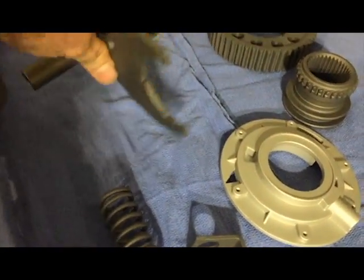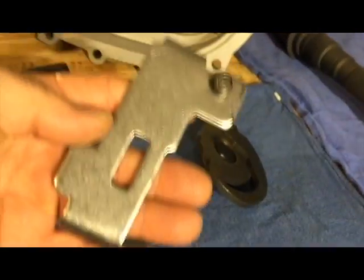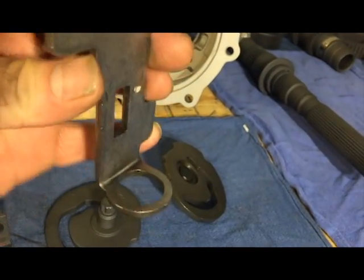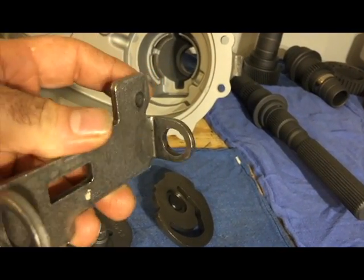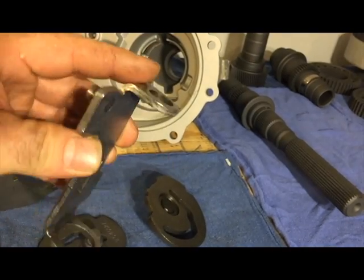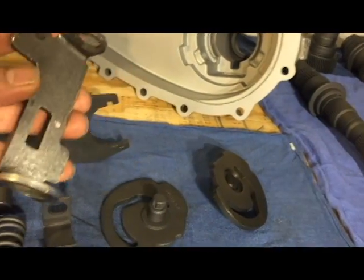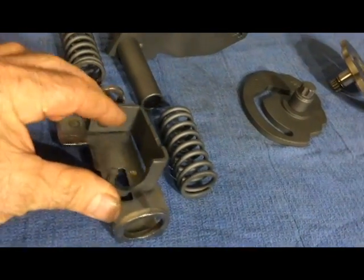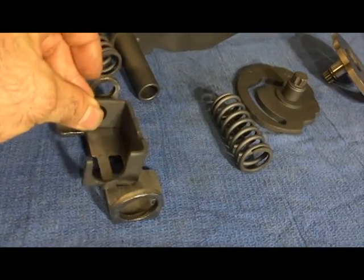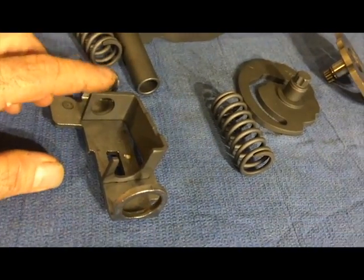Here's the range fork right there. Some of the parts — the springs and this piece right here — I didn't have this coated and I haven't polished it yet. I still have to clean it up. I got some really nice polishing pads from Amazon that I'm going to use. But these parts interact and there's a lot of tension and pressure on them. These parts have been Teflon coated — it sits in here like so and it slides back and forth, and you want that action to be as smooth as possible.